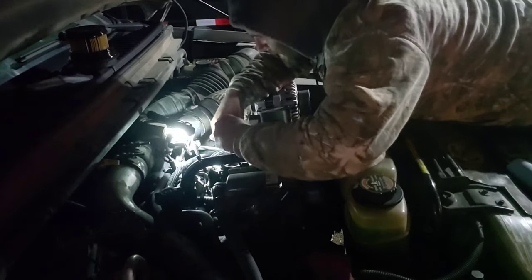It came down to two things. The option I went to was checking the fuse box — probably what I should have done first after checking the glow plug relay. The fuse marked number 30 is linked directly to the fuel bowl heater, and that fuse was blown. I pulled the fuse out, put a new one in, turned the key on, and it popped right away — that's what determined the fuel bowl heater being bad. Ended up going to the parts store — picked it up at O'Reilly's for $50. Advanced said they could have one in the morning for $85, but O'Reilly's had it, so that's where I went.